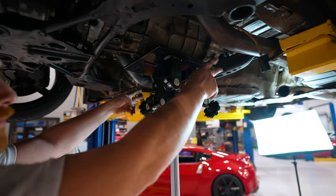So looking at number three right here, it should be like that. And then just take your palm. You can usually take your fist and get it to rest on those dowels enough that way you can take your hands off, grab your hardware, and we'll start torquing it down. So got our 12s? Yeah, 12s. Our nine of them for the pressure plate. So we're just going to start threading these guys in.